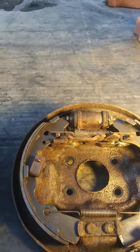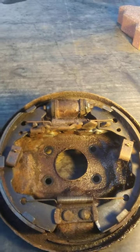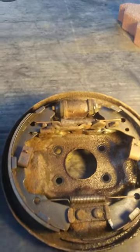it'll be safer. I want to illustrate this with a brake drum assembly that I removed from a 91 Mazda 626. One I have is cleaned up, and one I just took off and it's all dirty. All right, right here. Now I'm losing daylight, so I got to use this lamp. Okay, here's the one I just took off. Notice all the crud and corrosion on that thing. It's no wonder things aren't going to work and things will stick. Like maybe your parking brake may stick in the shut position or the open position.